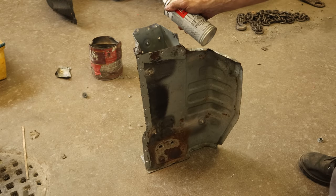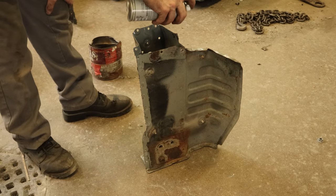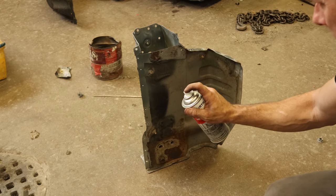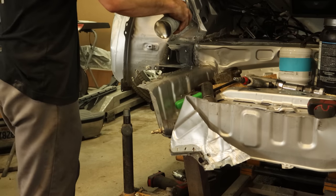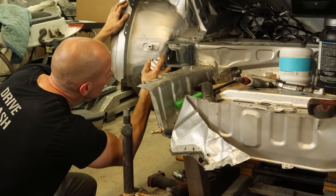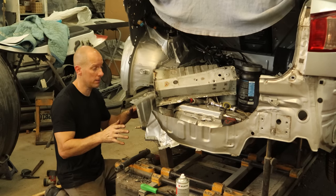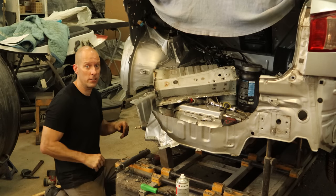So our new parts are all ready. We're going to prep them with a little weld-through primer. We've cleaned all the rust, metal, and paint off of our weld areas — mostly rust. We'll put our weld-through primer just on the bare metal surfaces that are going to be up against other bare metal surfaces. Now we'll do the car side — make sure you get the bottom; it's actually the most important part and the easily forgotten part. So that's about as far as we're going to go today. We got everything all pulled and squared; according to the measuring system, it's all right where it belongs. We haven't put this rail in yet to find out the bad news, so we'll save that for next time. Thanks for watching and I'll see you soon.